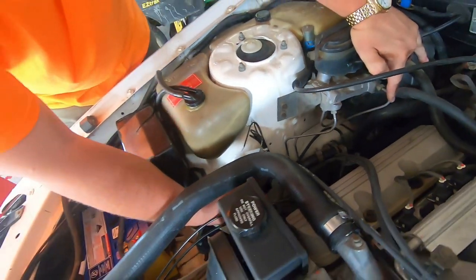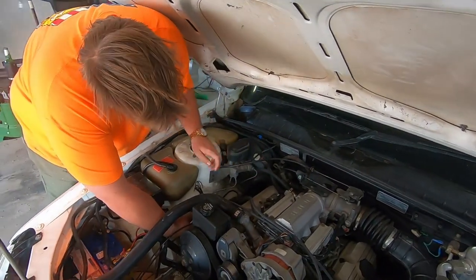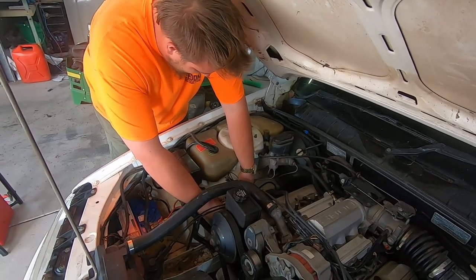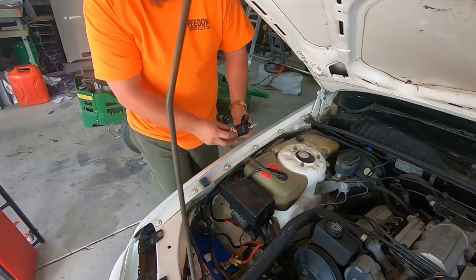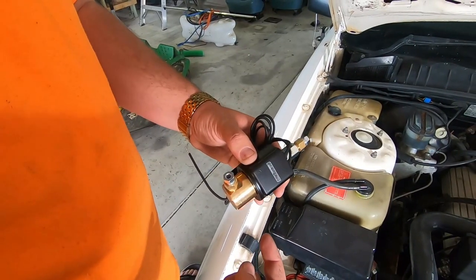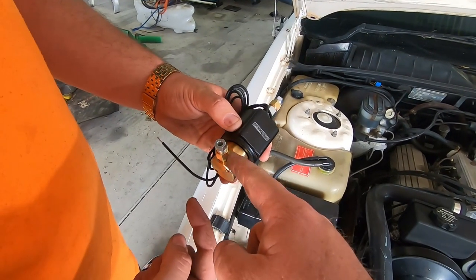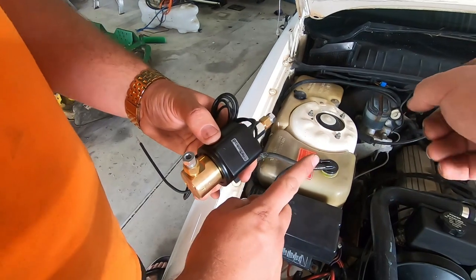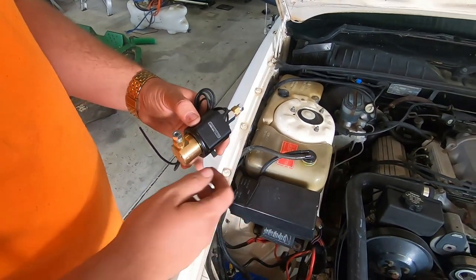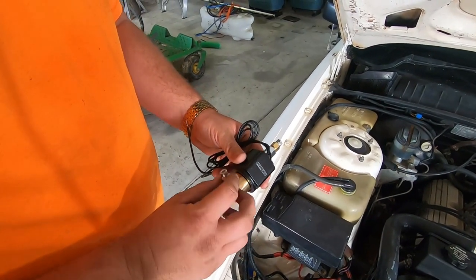Cut this back brake line off. Yep. Straighten it out. Fit it into whichever side it has to fit into. Yeah, so it's going to come from the master up here. It's going to go into the out, which is opposite to the way it should be. And then it's going to go through here to the rear brakes. Out of the in. Yep. Because we like to do things backwards. Yeah, that's right. She's a good girl.